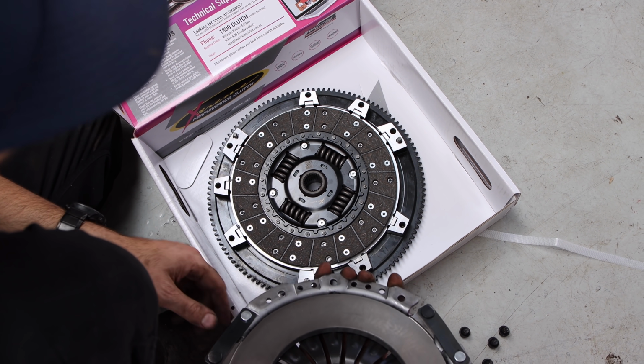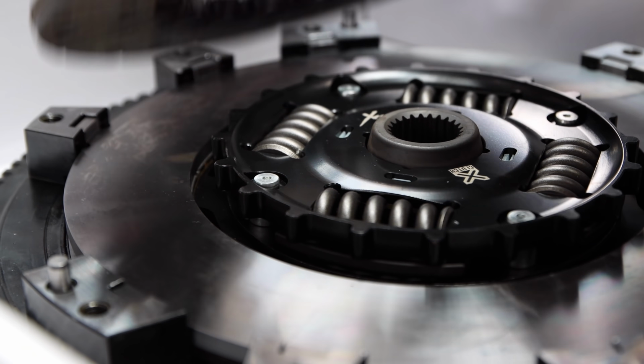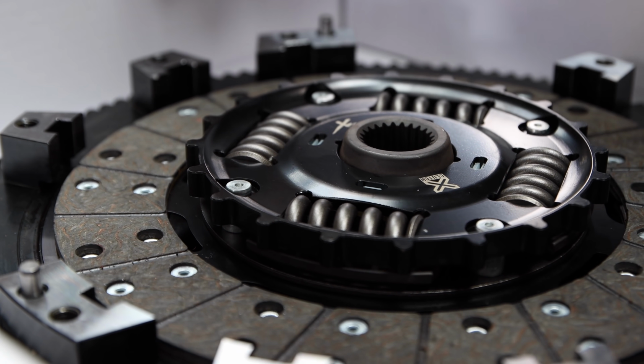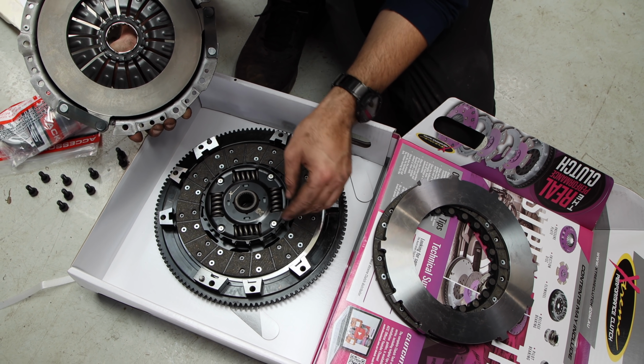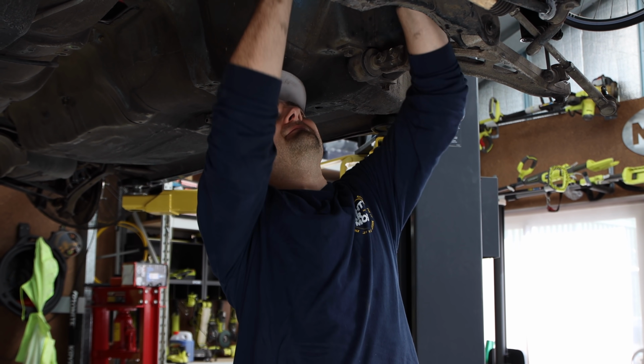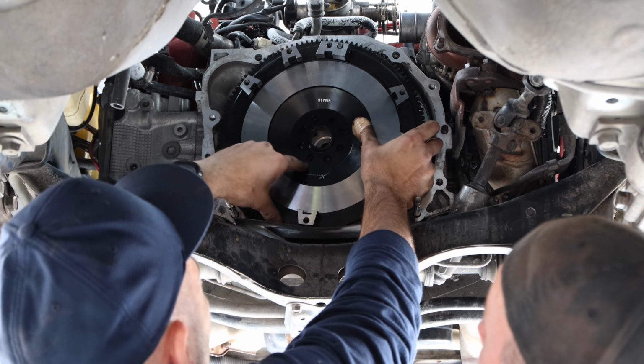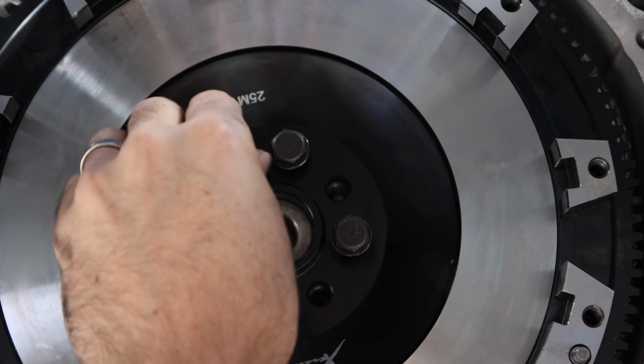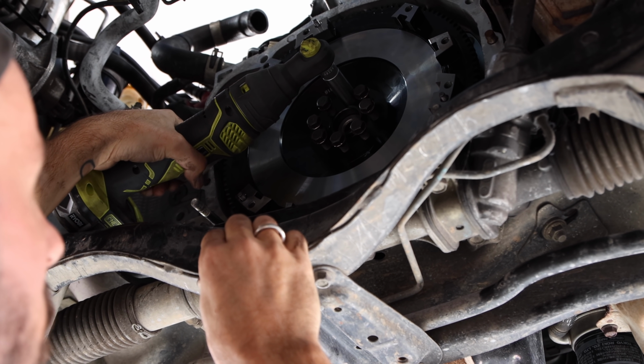A twin plate clutch can often handle more power and torque than an equivalent single plate due to the fact you've increased the surface area and often also the clamping force. You can dive deep into clutch theory wormholes if you like, but something common between all clutches is that changing them usually isn't a quick, easy or fun job. Get the best one you can the first time to save lots of time later on.